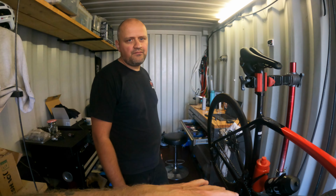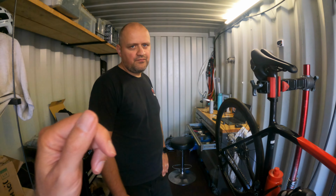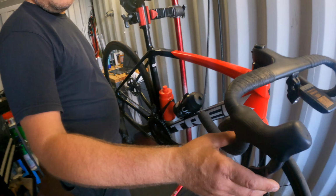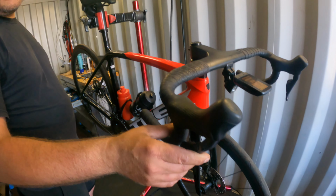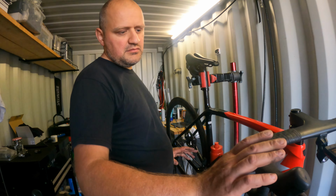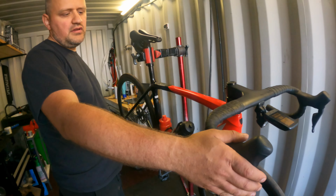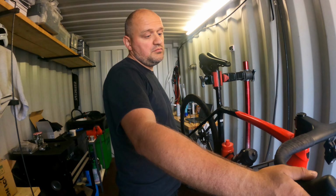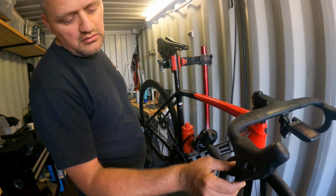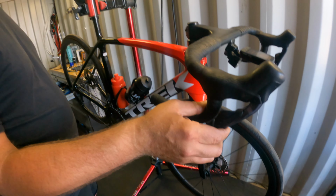If you're cycling and you haven't gone to a mechanic, how would you know the thickness, how would you know it was wearing down? Is it the handle? Well, the first sign is, okay, my brakes were not like this before. Either your brakes were not bled correctly, or some bubble travelled from the system into the reservoir in the lever. Or an indication is, okay, I've had the bike for 3-4 months and I rode a lot, I used to brake a lot, and the lever is going very close to the handlebars, maybe even closer. I'm squeezing more.